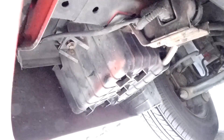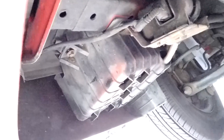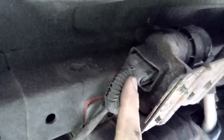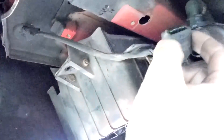That large box right there is the problem component we're going to replace. There are three fasteners holding it in, all using a 10 millimeter socket. Here's the first one you're going to remove, then there are two more right up here — I already removed those two. There's also an electrical connector right behind the last fastener that you'll want to remove so the whole unit can drop.